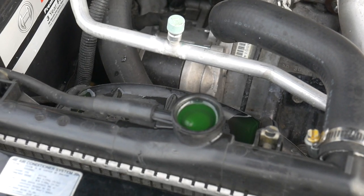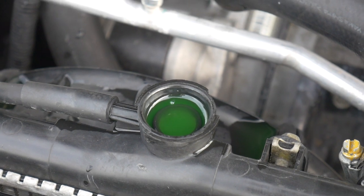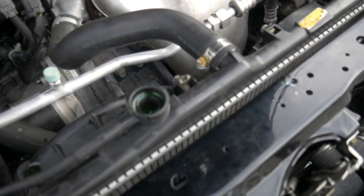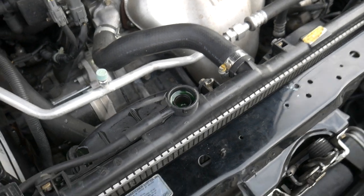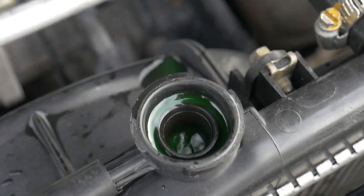As you can see here, as the engine is just idling, it's getting a lot of the air bubbles out on its own just by the motion of the water pump. To make this process a little bit quicker, I'm having Matthew sit in the car and just press the gas ever so slightly to get the idle up. It just makes the process a lot quicker — you can see all those air bubbles still coming out.